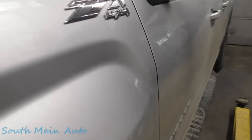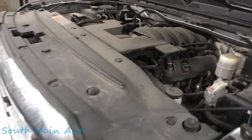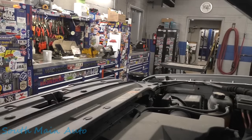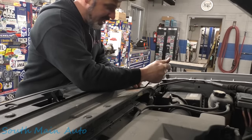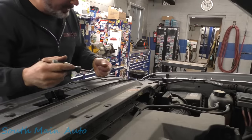Working on a 2017 Chevrolet — big Z71 with the 5.3. It's got a check engine light on. The code is for loss of communication with a device on the LIN bus, and this code is in the PCM.